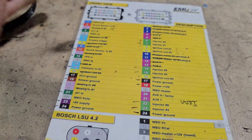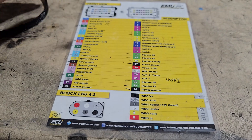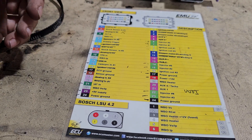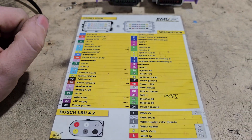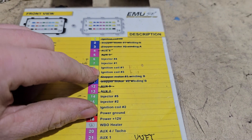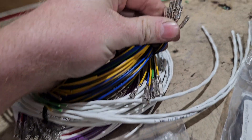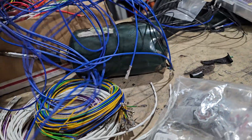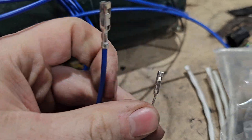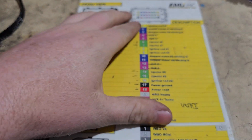Now we're going to the gray connector — the black connector is finished. Some ECUs will have far more inputs and auxiliaries, like a drive-by-wire setup, six individual EGTs, or multiple pressure sensors. Number one on the gray connector is ignition coil six — same as all the other coil pins. Make sure you are not putting small pins in the large-pin positions. If you're learning this for a Haltech or other ECU, everything shown here will carry over to other ECU pinouts.